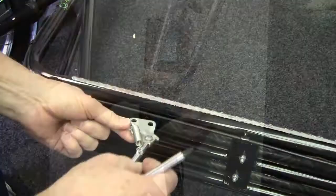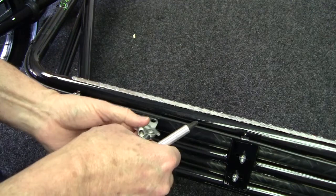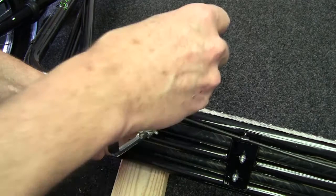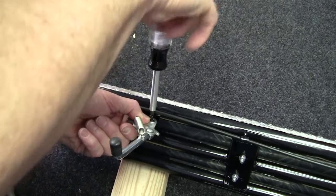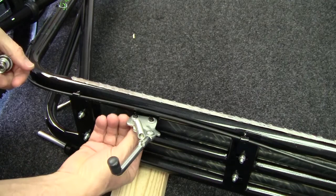Tighten all four nuts. We're almost done — we just have to put on the kickstand and hook up the brake lines. To install the kickstand, use the 5mm screws with a washer. Slide the kickstand onto the little tab welded on underneath, and make sure the brake line is out of the way. Don't tighten the first screw until you get the second screw in. After you get both screws through, take the small zip nuts and put them on the back side, then tighten the nuts down with an 8mm socket or wrench.